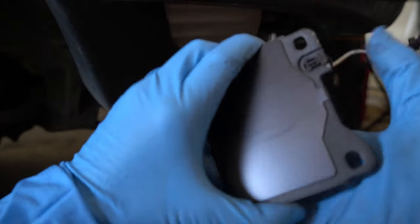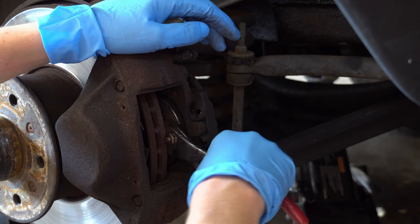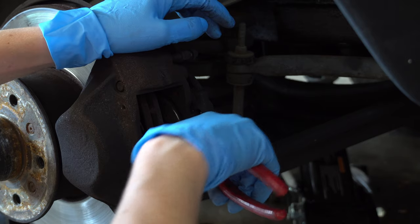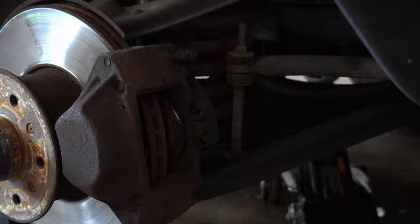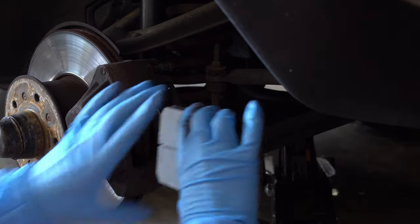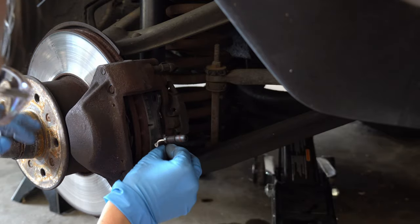Here you can see where old and busted meets new hotness — the brand new pad with the old brake sensor installed. The old brake pads were pretty worn down, so the pistons were pretty close to the rotor. I've got to scoot those in and really make sure they're getting compressed, pushing them toward the caliper and away from the rotor. Be very delicate with the piston seals — you do not want to damage those or else you'll leak brake fluid. Apply the brake pad grease to the back of the pad; definitely do not want this on the meaty front side. Ensure that front side is facing the rotor with the greased back facing the caliper, then slide it into place and repeat on the other side.